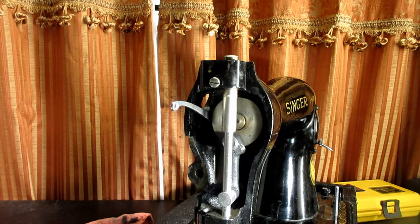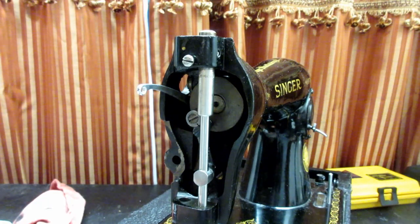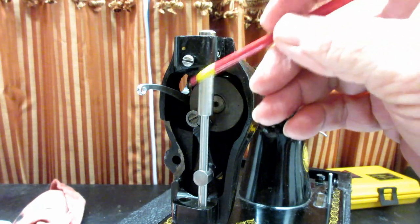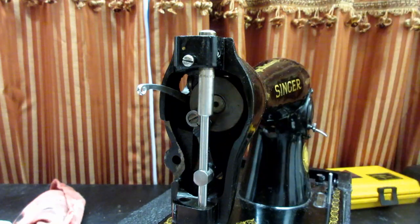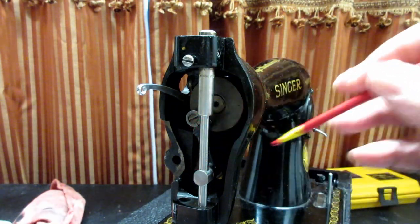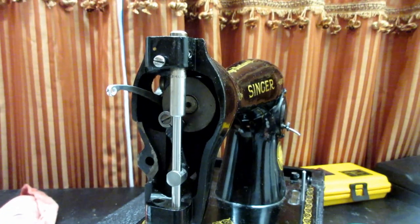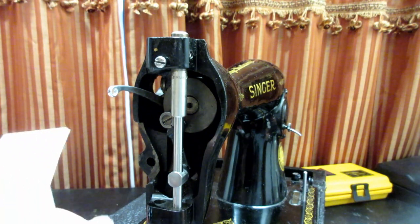Now what about oiling the upper needle bar bushing? Here's the deal about oiling the upper bushing for the needle bar. If you saw my presser bar video, I found a part was missing — a little piece of felt that goes into that thumb screw up there to hold oil. I had ordered a couple of firm felt cords from McMaster-Carr because I wasn't sure of the size. I ordered a quarter inch and three eighths — turns out three eighths was a tiny bit too big but went in okay, and the quarter inch was too small and too narrow in circumference.